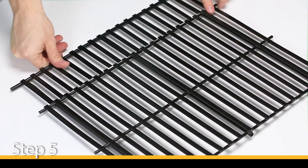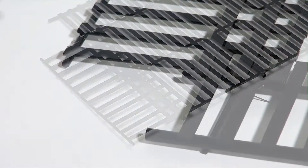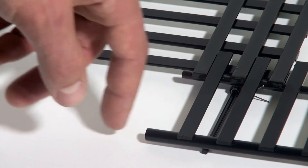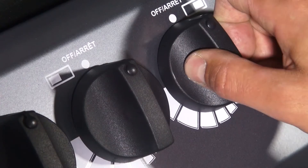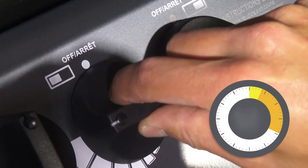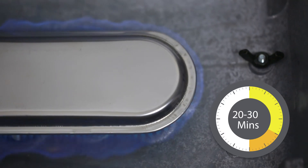Note: when extending universal cooking grids to their maximum size, a small area of the grill will become unusable. Position this area in the back corner of your grill if possible. Before using your new replacement grid for the first time, it's important to light the burner and leave the grill on high for 20 to 30 minutes. This will burn off any residue from the manufacturing process.